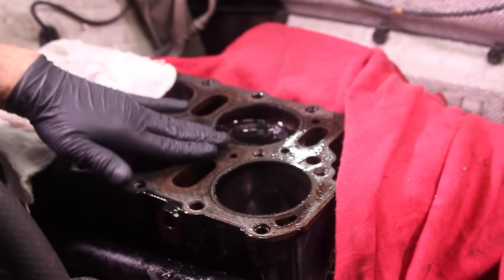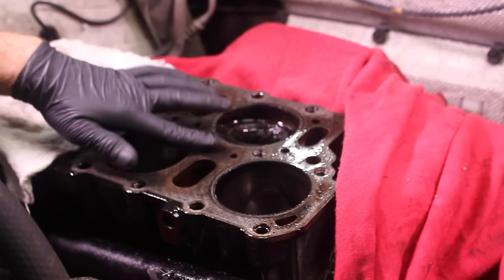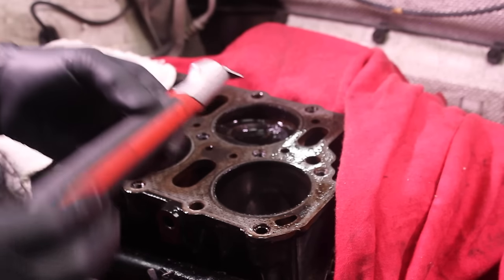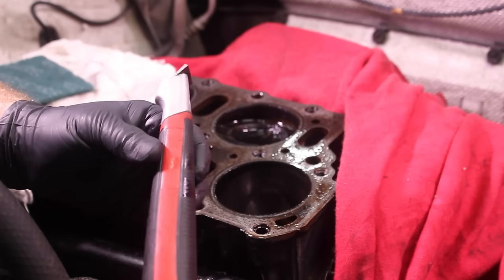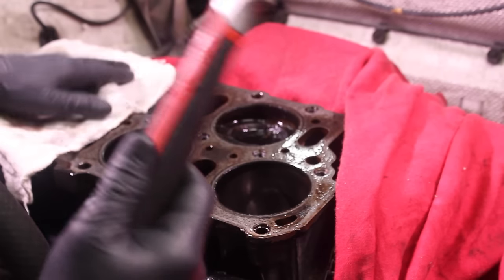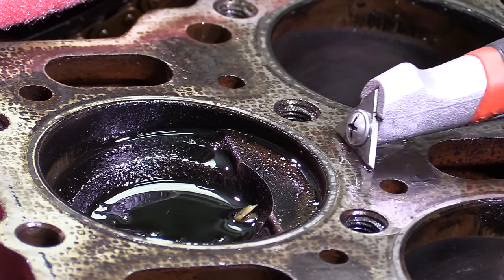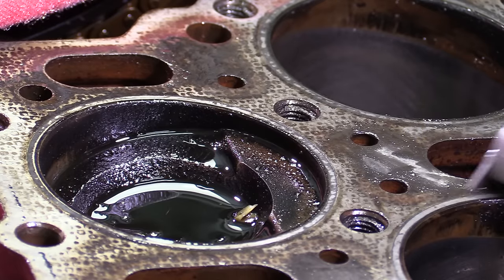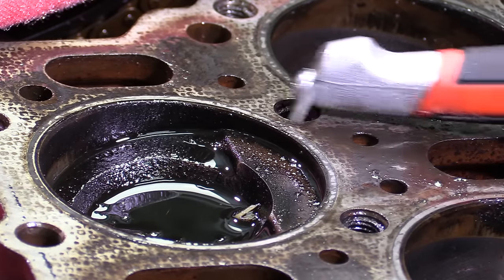It's up to you whether you want to start on the block surface or on the piston and cylinder wall — I like to go back and forth between them. This scraper is a Blue-Point scraper; it is one of the best scrapers I've ever used. I'll throw a link down in the video notes. One of the best parts is the tip is replaceable and I think this thing was only about 20 bucks, so I highly recommend it. Our goal here is not to take metal off, so you don't need to apply much pressure — simply a back-and-forth motion of the scraper does enough to remove most of the material. We're just trying to get the high spots here and we'll come back with the Scotch-Brite pad.